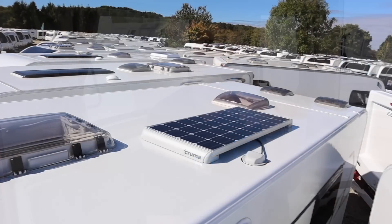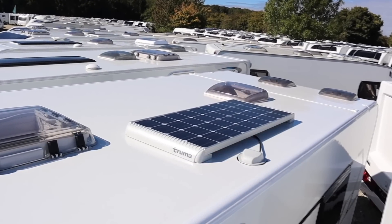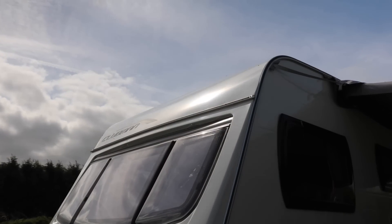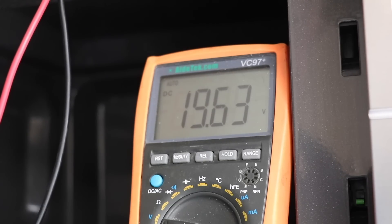In the context of this video, let's discuss leisure vehicles. You might be thinking that the solar panel outputs 12 volts if we're talking about a 12 volt system — well that really isn't the case. The output voltage from the solar panel can actually swing quite a lot; it can be quite low and quite high. This is down to the weather, the angle of the sun, the position of the caravan — in fact any environmental change can have a huge impact on the voltage of the panel. Let me take my multimeter and plug it into the solar panel here at the controller in the cupboard. As you can see, we have anywhere between 19.5 and 20 volts coming out of the panel.